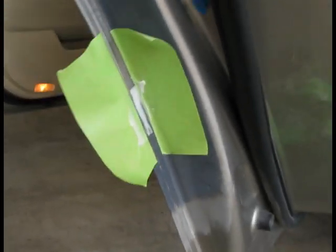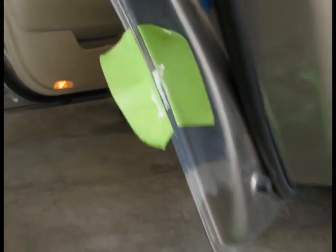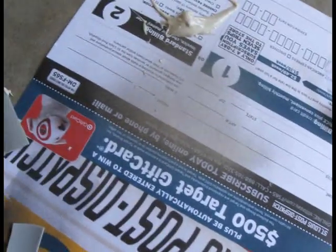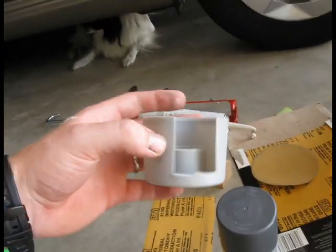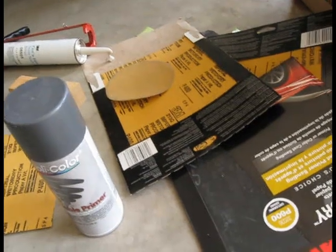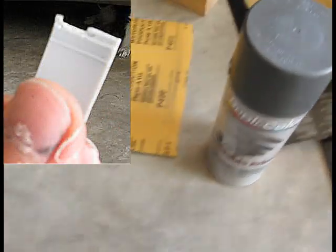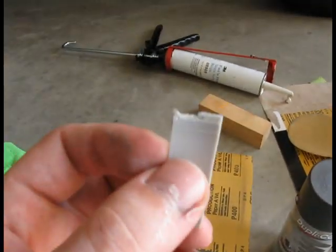So this is how it looks after application. I've secured my repair area here so I wouldn't make a mess, and those little tools, if I can call it that way, I simply cut them off from my used spray can. They were very good with spreading, especially this one, with spreading seam sealer to replace the factory one in the damaged area.